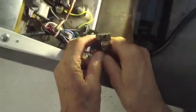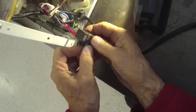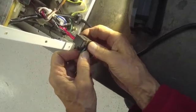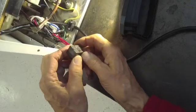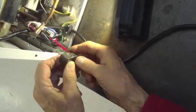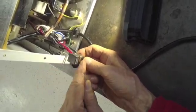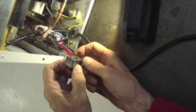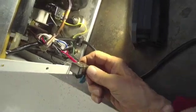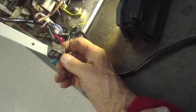This is an amperage relay. The way this works is that when power is sent through this relay, it has a plunger inside. This is the start winding and this is the run winding on the right. It allows the power to run through both ports to engage the start winding — quite different than a solid state relay.